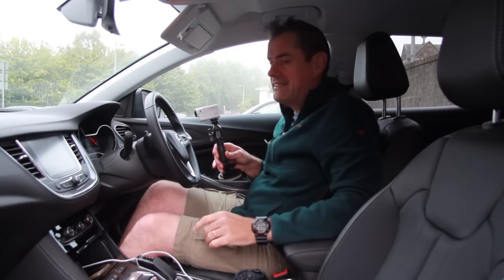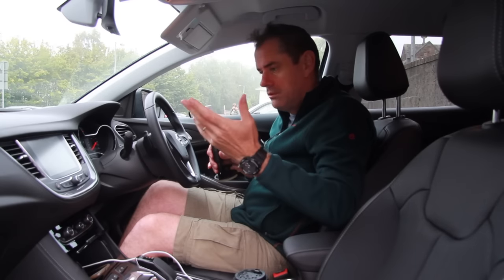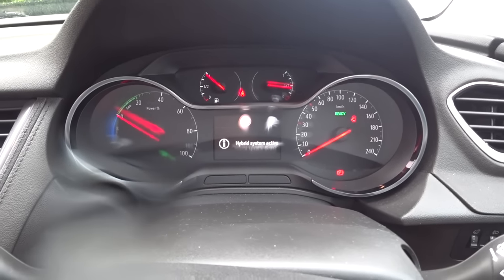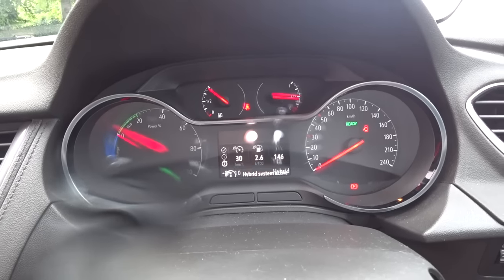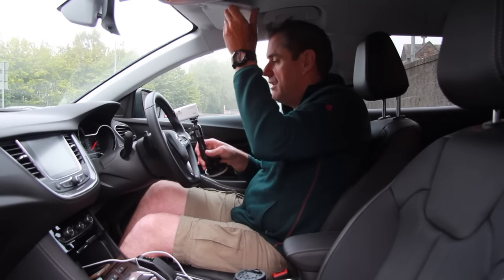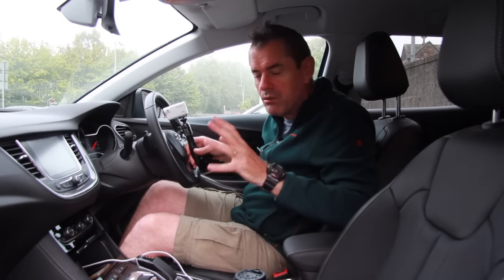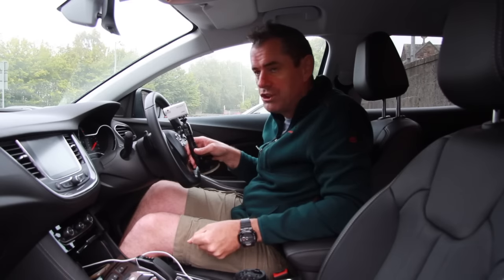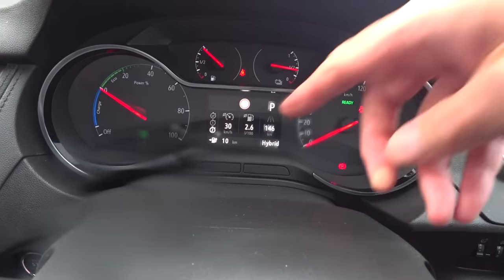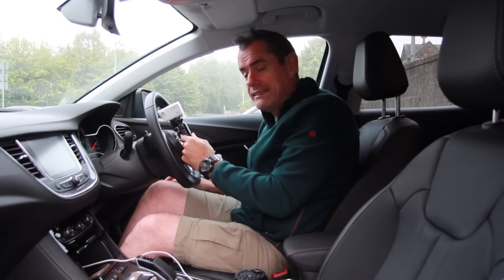Turning it on — the petrol engine cut in for the first time in three days, because I've nearly run it out of charge. I think it's just heating itself up. It'll shut off in a second. I've run this car for the last three days on pure electricity — driven the kids to school and home, back and forward to the shops, charged it up in the afternoon for about two hours on a 7.4 kilowatt charger and gave it a full charge again. My fuel economy is 2.6 litres per hundred kilometres. Think about that.